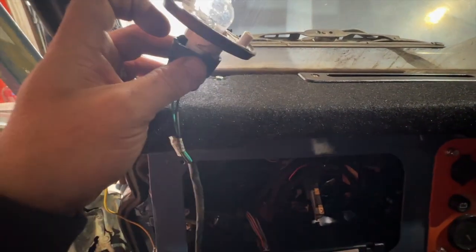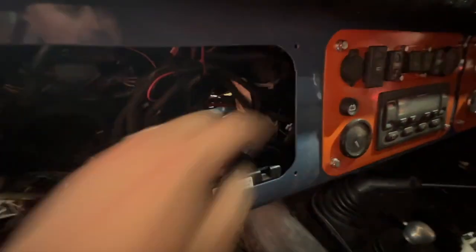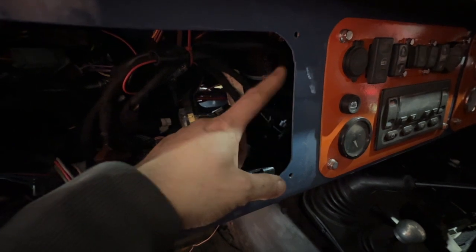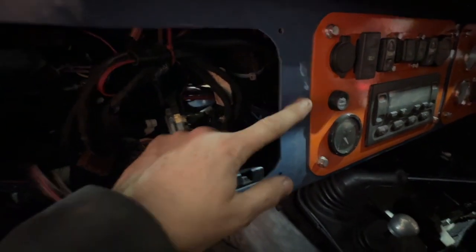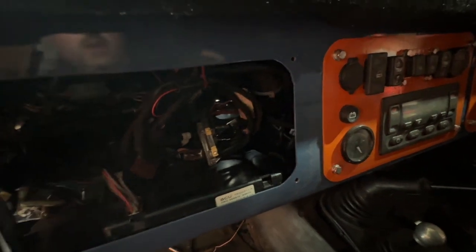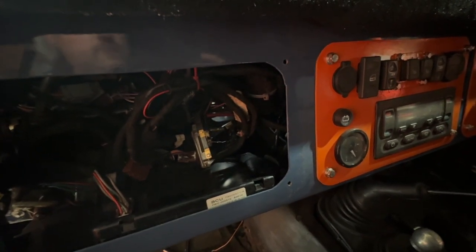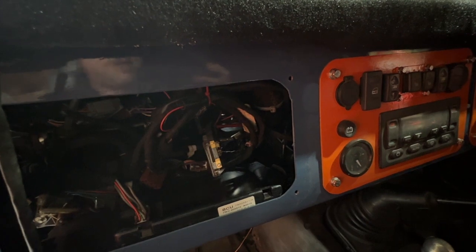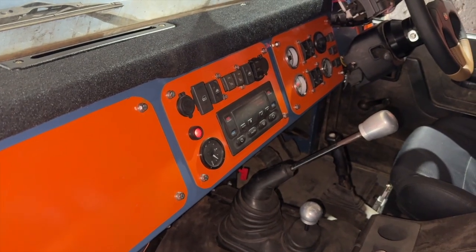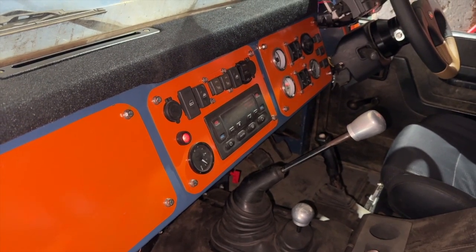I've got another side light and I've put that in instead of that bulb — still no light. I've just checked the connections and I'm getting 12 volts to it from the auxiliary battery. I've just earthed the other pin and the light works, which tells me it's the alternator. I even put a wire from the alternator straight to the back of the bulb as well, and no joy. So that kind of tells me it's the alternator — but that's brand new. Looks like we'll have to sort another alternator out. I've just earthed the body of the alternator — it's obviously not getting a very good earth through the powder coated bracket. So we need to put an alternator earth on. That's fine.